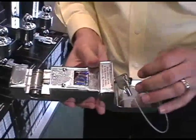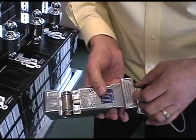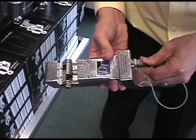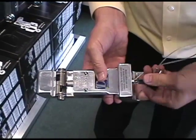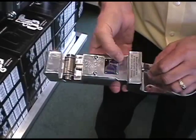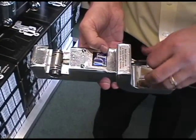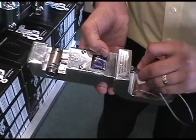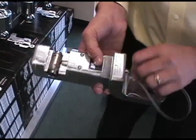We have here a cutaway ball mount showing the inside of the hitch — we've cut out the aluminum so you can see it work. You can see it working similar to a crankshaft and two pistons in an engine — a very solid-state system. When you turn it, two cam lobes retract the pins. These are stainless steel and O-ring sealed. There's also an O-ring up top in case the rubber cover gets left open, so water, salt, and debris will not get in. That's a new feature on the second-generation design. It's fully watertight and packed with corrosion-resistant grease.